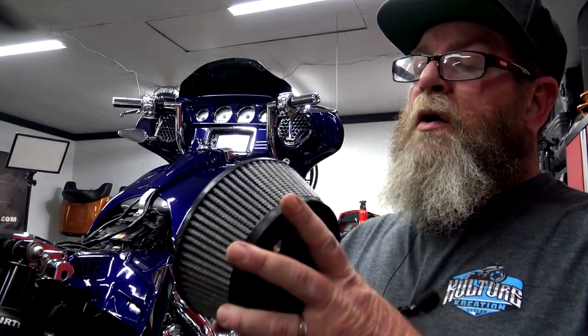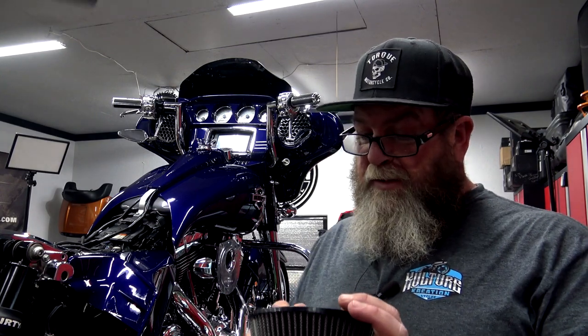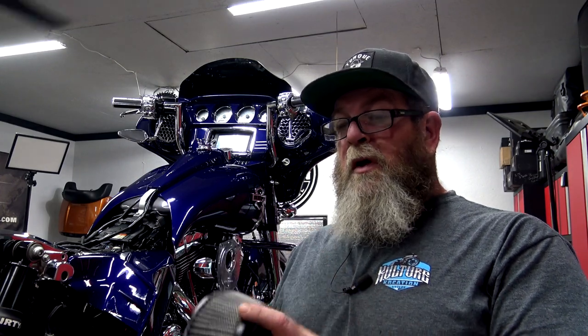This style air cleaner from Arlen Ness is a reusable air cleaner that you just clean with hot soap water — spray it out real good, let it dry, and put it back on your bike. Before I get comments about using brake cleaner, remember that stuff is highly flammable, so you do have to let this dry before you put it back on. As far as the Arlen Ness instructions go: use soap water. But you do not want to put this back on your bike still wet and go for a ride, because you're going to suck a bunch of water into your intake and have a really bad day. Make sure you get it super clean, super dry — do this in the evening and put it back on your bike.